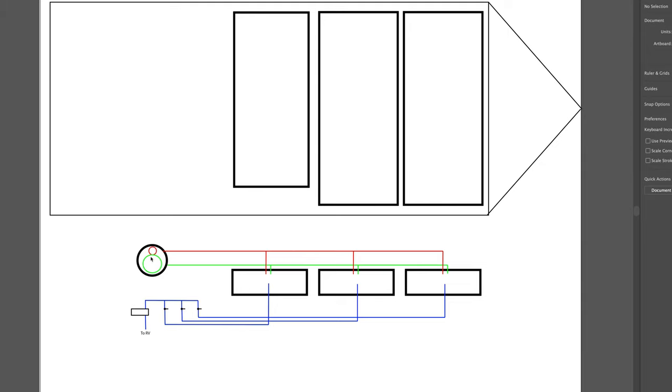When we fill in the water here, gravity feeds it and fills up the first tank. When that pipe is filled, it moves on and fills up the second tank, and then the third tank. Then there's back pressure in all of these and it will start overflowing. I recommend you do individual overflow pipes because this pipe is not straight — it's kind of wavy, and air bubbles get in and don't let the water escape. So it prematurely fills and squirts out the hole. What I do is fill it up as much as I can, wait 5-10 minutes for the bubbles to pass, and then I can actually put in another 20 gallons or so.